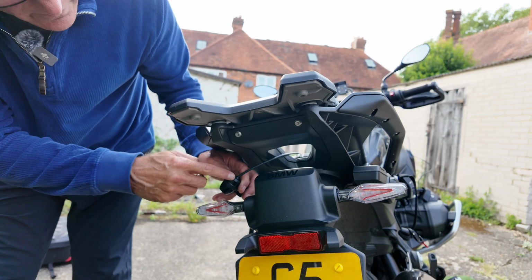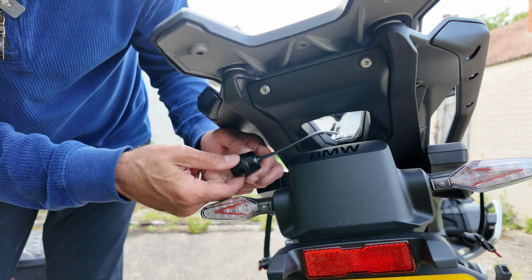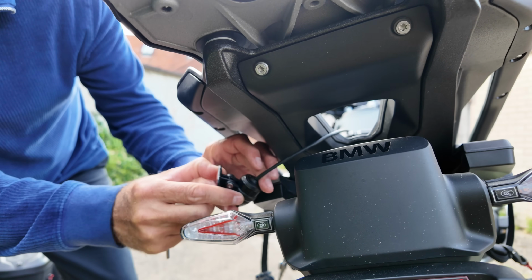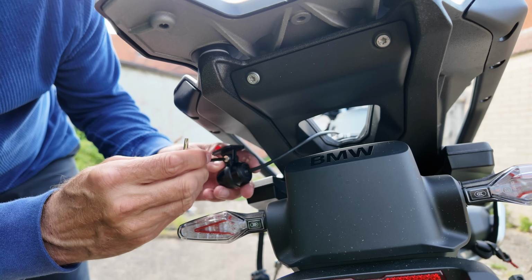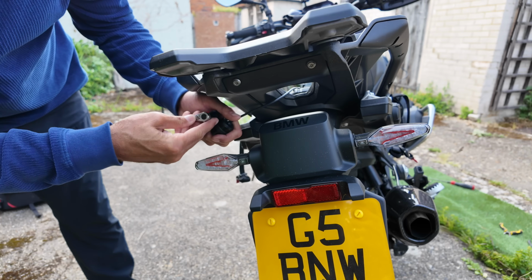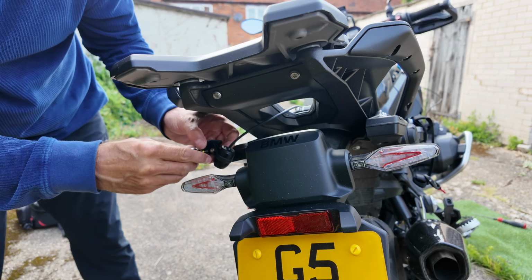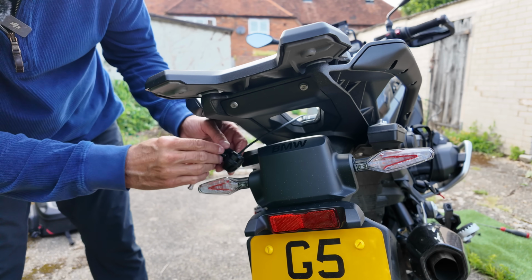So these cameras have got a notch on them. If you're putting it upside down, you need to spin that notch to the top. Otherwise your picture will be upside down. So line that up with the middle of the bracket and then nip it up with the right tool. Cut. Nip this up. As tight as you can. Well, not as tight as you can. Keeping it level.